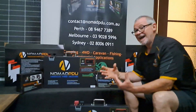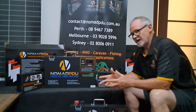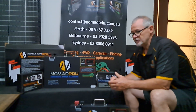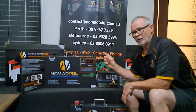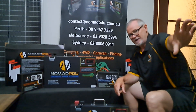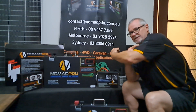How do you stop your crank battery from going flat? You would have heard electricians talk about a relay — it could be a VSR, a solenoid, all sorts of things depending on who you're talking to. Typically you're going to have the crank battery go to what we call a VSR — a voltage sensitive relay. All the relay does is detect the voltage in your crank battery, and when it starts to come down, the relay shuts off and stops the current running through to the next point.